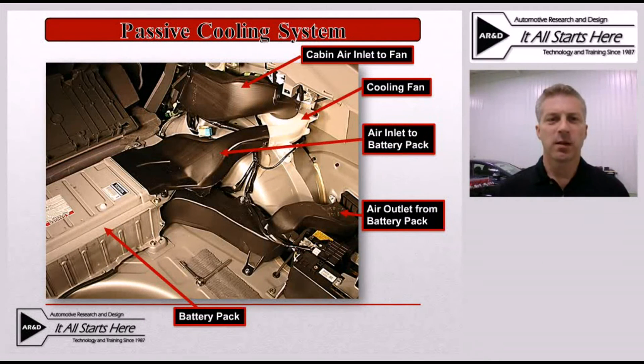If you viewed the P10 tech tip on hybrid battery cooling systems you should be familiar with this picture already. This picture is from a 2004 to 2009 second-gen Toyota Prius. As you can see, we have an inlet duct that draws air in from the interior cabin at whatever current temperature the inside of the vehicle is. It draws the air through the fan and pushes it into the battery pack, entering the top of the battery pack, forcing the air down between the modules, and exhausting it out of the bottom to the outside of the vehicle. This allows conditioned cabin air to flow between all the individual battery modules to remove any heat generated from normal operation.